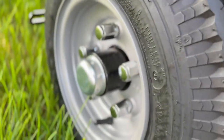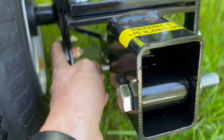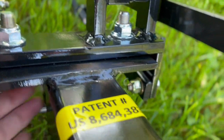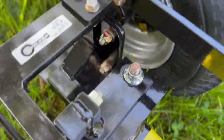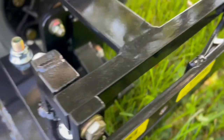I've attached the wheels. Each wheel has five lug nuts, not completely torqued down yet. The wheel assemblies attach to the hub assemblies here. The hub assemblies have a slider for alignment and connect with some pretty heavy-duty bolts. The back bit goes around the back of the scooter, and on the other side it's the same. It's a relatively easy process, but you do have to make sure you get your torques right.